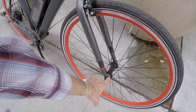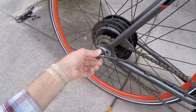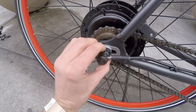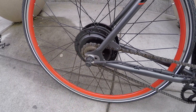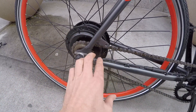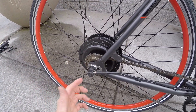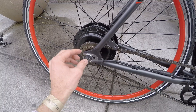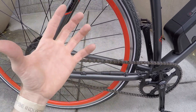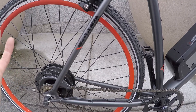There's no quick release — it's a 10-millimeter threaded axle up front and what looked like a 12-millimeter in the back. You can see the power cable protruding from the right side of that axle — this cup may have been bumped a little bit. This is something to be careful with: if the bike gets laid down with no kickstand, or if you're riding close to something and it gets snagged, you don't want this damaged because then your motor is done. It's a little bit of vulnerability, but not too bad. At least it's at an angle rather than protruding straight out. There's a quick disconnect right here so you can deal with service, take off the wheel, fix or change the tire.